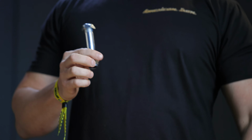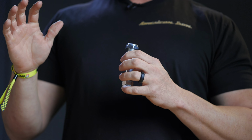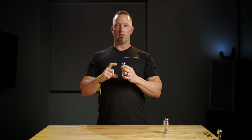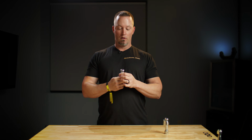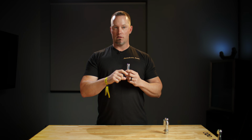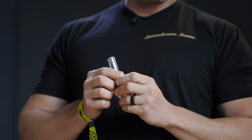The upper is actually responsible for setting the rotational axis just like our typical ball joint, but we don't have a telescopic stud like a regular upper ball joint. A regular upper ball joint actually has play in the assembly to account for casting variances in the C and the knuckle. We don't design things that way. The joints that we design do not have play inside the joint to account for the variances. We account for the variances in the top of the stud, hence the double-ended stud design.